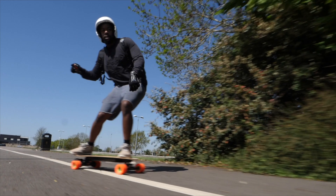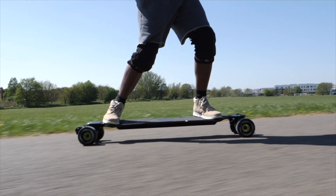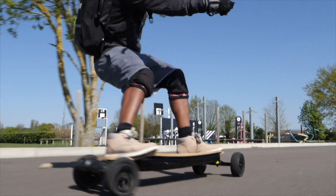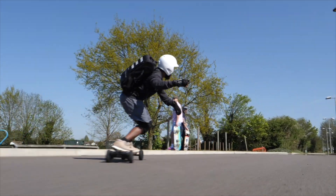So the general rule of thumb here is: when you go with a smaller gear you're going to have a better top end in terms of your speed, but your acceleration and your braking will be a bit softer. Now in reverse, when you go with a bigger gear your acceleration and braking will be much better, but your top speed will suffer.